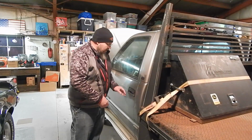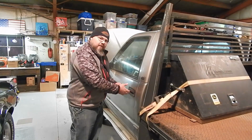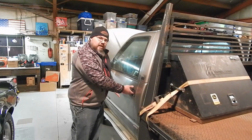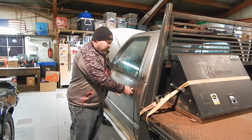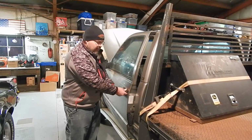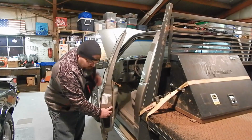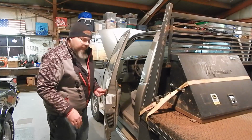And we'll get into that. Hopefully, a lot of times the bolts back out of these. It's a real short bolt, they don't have a lot of bite. Hoping that bolt's just backed out and has fallen inside that door. If not, we'll come up with a door handle solution. But you can hear how that drags out of there real hard. What that'll do is chew up your latch here real bad, and once that starts happening, you got big problems, guys.